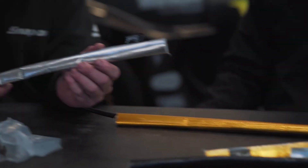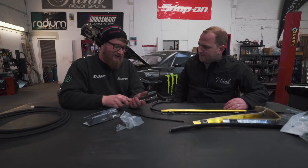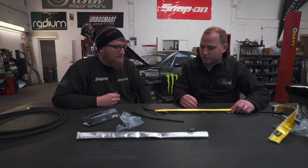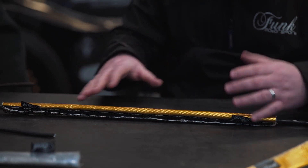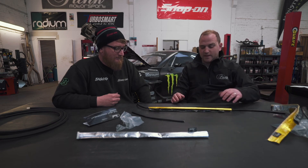This is good if you've got a part that you want to service regularly but don't want to keep sliding off the heat shield — maybe you don't want to put unnecessary stress on it. This is perfect because you can easily take it apart. It's only Velcro, just keep that Velcro away from direct heat sources. It's easy to get to and service, whether it's an AN line or a brake line — get in there, check it, then reseal it back up and it's going to do exactly the same job. Some people use this on fuel rails, essentially just cutting the appropriate holes for the individual injectors. Or some people pop the injectors out of the Velcro, whatever works. Just because it's fixed how it is, doesn't mean you can't customize it with a pair of scissors to make it work for your application. Everything can still go around corners, work nicely, and tidy things up — it's a really versatile product that a lot of people overlook.